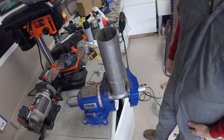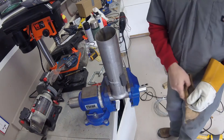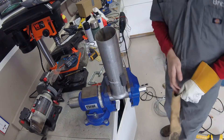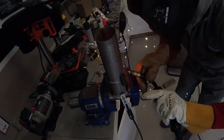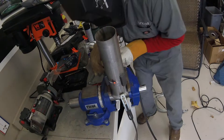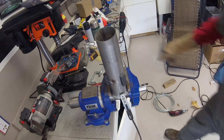The witness marks are made when I'm under the vehicle so I know I have two points where the pen dragged over — that's where they need to go to maintain the angle and orientation I need when I go to weld the pipes together. Now that I have my joint exactly how I want it, with magnets holding it in place and witness marks double-checked and lined up, I'll go ahead and throw a couple of tacks on it. All tacked up.